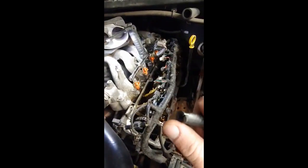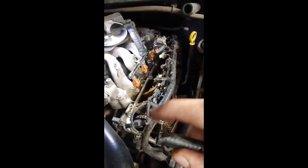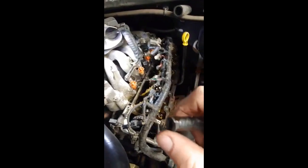One thing that's pretty handy you should do often is clean that hole out. So I taped a hose to the end of my shop vac and just run that down in there each time I run any tool down in there, several times. Keep that clean. I don't know if that hose is marked what size it is. It fits through the spark plug hole, so it actually goes down in the cylinder. One thing I did last time is I cut some little slots in this hose so that it kind of flares out and lets me pick up a little more junk that's down there.